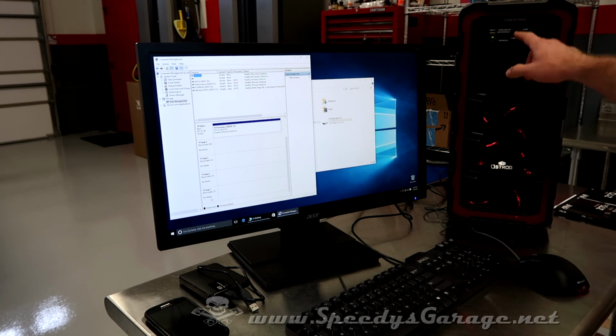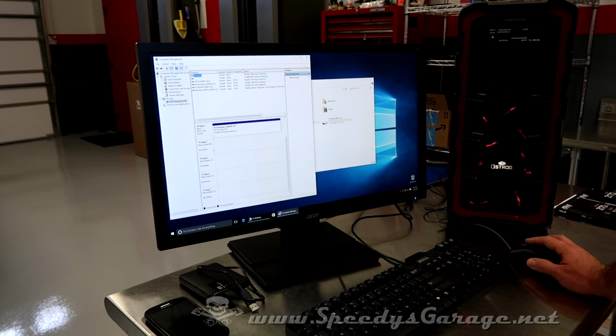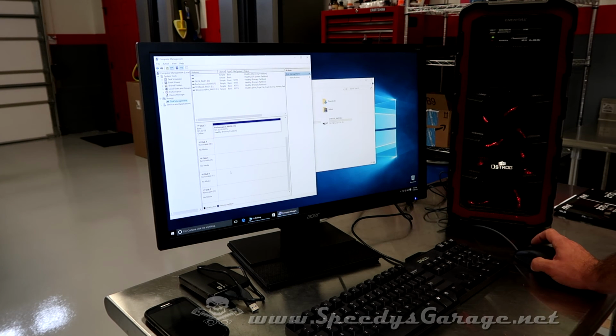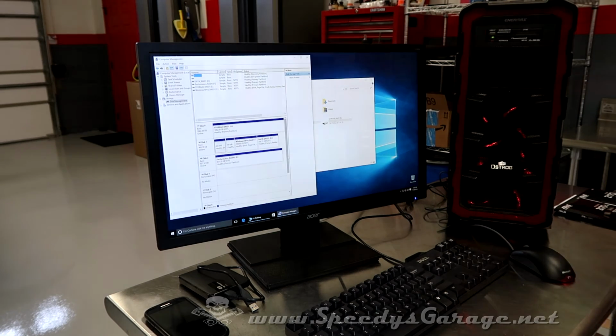I always take my USB ports that have the smart card or SSDs or whatever else they are, compact flash, SD, mini, etc. And I start at Z and work backwards. And so that way these are out of the way. And I usually did the same thing back in the day with the CD-ROM drives. I would give them a very high drive letter just to get them out of the way as well.